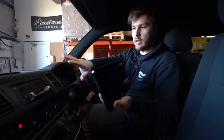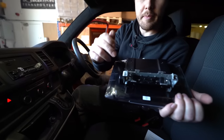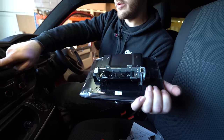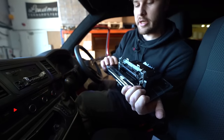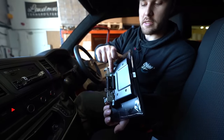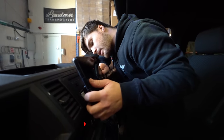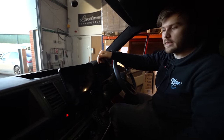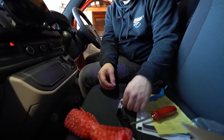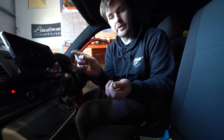I've grabbed the screen — the radio is in place in the dash. We're going to line up the pegs through the two holes just here, and once we've got that lined up it'll make the electrical connection, then we can bolt it in place via these two fixings. I'm just going to line it up and drop it in place, then we'll screw it in and get it powered up.